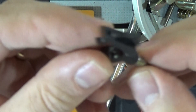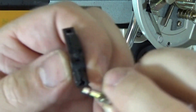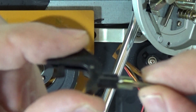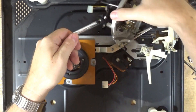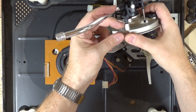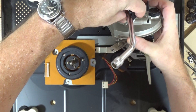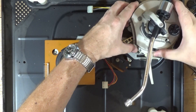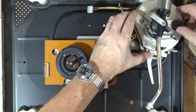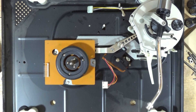So, drilled it out. It's a little loose in there. What I'm going to do is use some UV glue, or probably super glue since it's plastic and metal. So I put some glue on there, set it in, and this will be the new tonearm stand. I put that in there, attached it. It sits up a little bit higher — there is that little piece of exposed metal, but that's pretty close. I'm pretty pleased with using that replacement part. All I did was put a whole bunch of UV glue down in there and prayed that I got it aligned the first time when I zapped it, and I did.